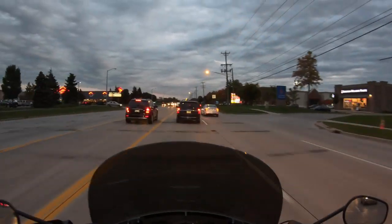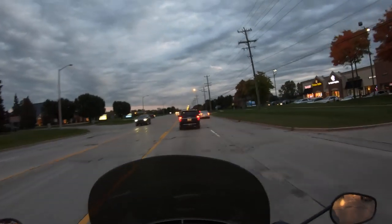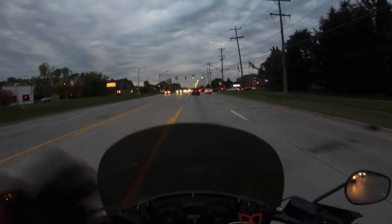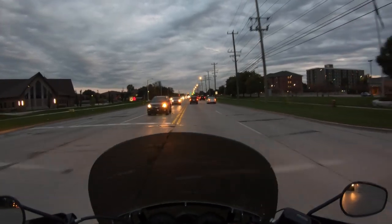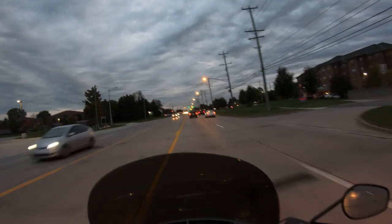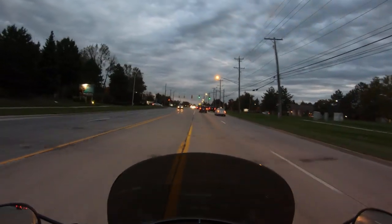Because if you don't know, these Milwaukee 8s also have oil cooling on them. For the ones that don't have the water cool, oil runs through the heads, and you get to have all that pressure in there to keep it going. So what you need to do is vent your oil system. That is the solution. The 100% solution to your sumping issue is to vent your oil system, relieve that pressure inside the crankcase, relieve that pressure from the oil system. Then you can put your high flow oil pump on there and get your flow going like you want.